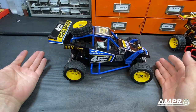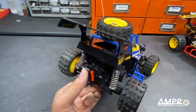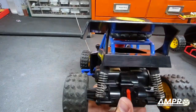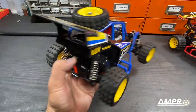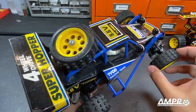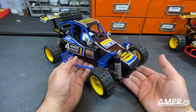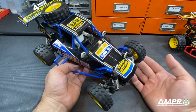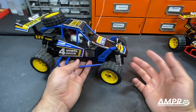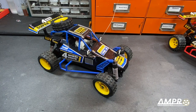This car is genuinely four-wheel drive. Coming around to the rear, we have slow and fast speed on the gearbox. Looking more closely, we see one motor and two motor positions — this is a dual motor setup. We have a rear differential and a front differential. So although it will be a little better off-road, you still have the limitation of open diffs — technically making it two-wheel drive. But an open diff is most likely a better option for dirt or pavement applications.